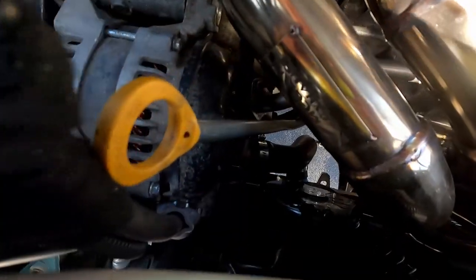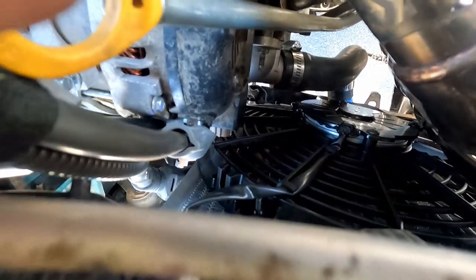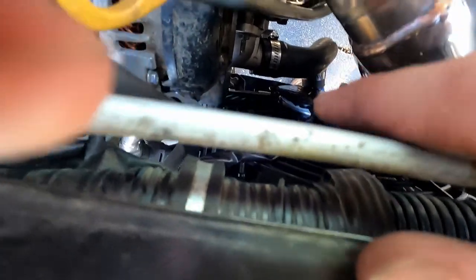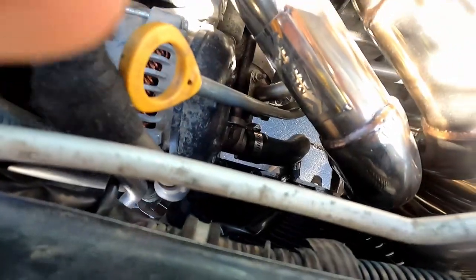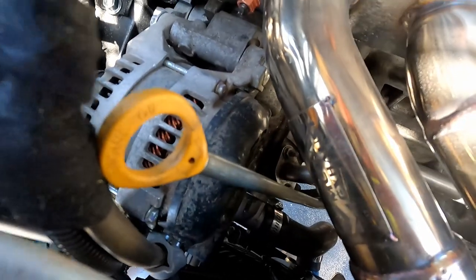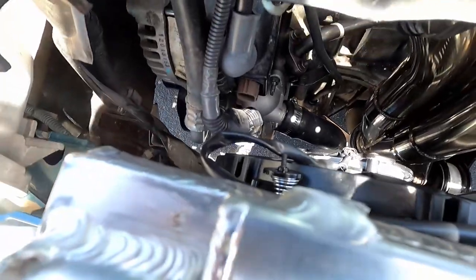Because what's actually happening, I don't even think I can get it on video. The connector runs into the fan, not the radiator. And this fan is mounted as low as it can go, so I couldn't mount it any lower to get the clearance for that, sadly. So I'll check Toyota's catalog, see if there's anything else that has the plug in a different spot, but I'm most likely just going to have to pot that connector.